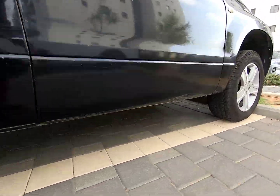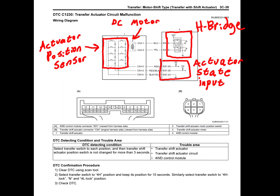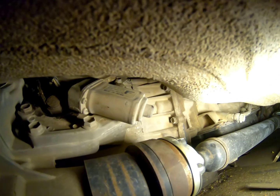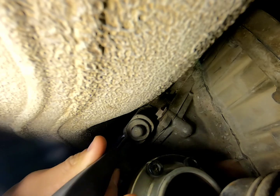The actuator is hiding beneath the car, right on top of the front prop shaft — you can see it here. Check out the electric diagram: resistors, motors, and H-bridge. And that's how a corroded motor looks like — that's what I found on the internet. I'll start with removing the motor cover, which is holding the magnets; what's holding it in place are three Phillips bolts.